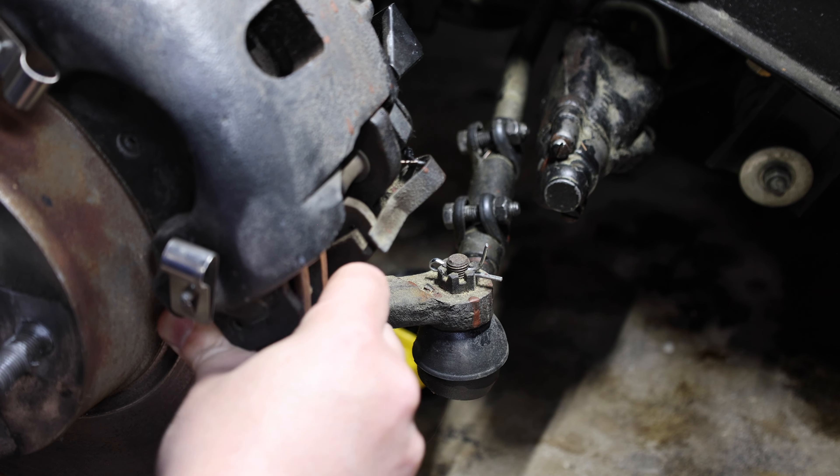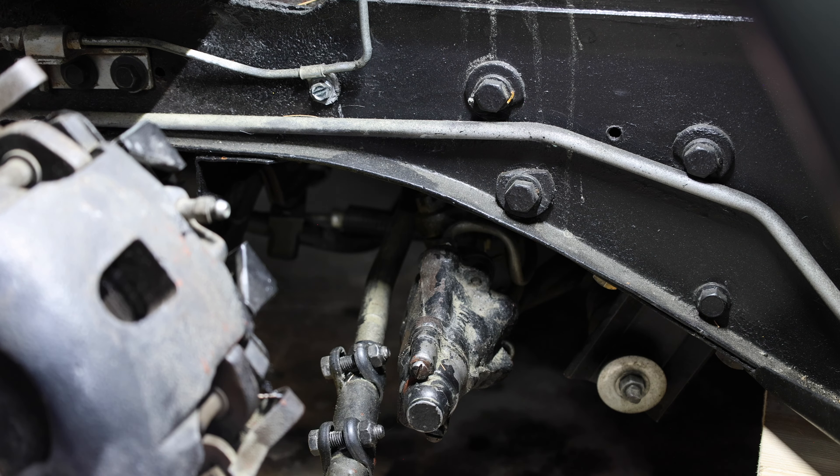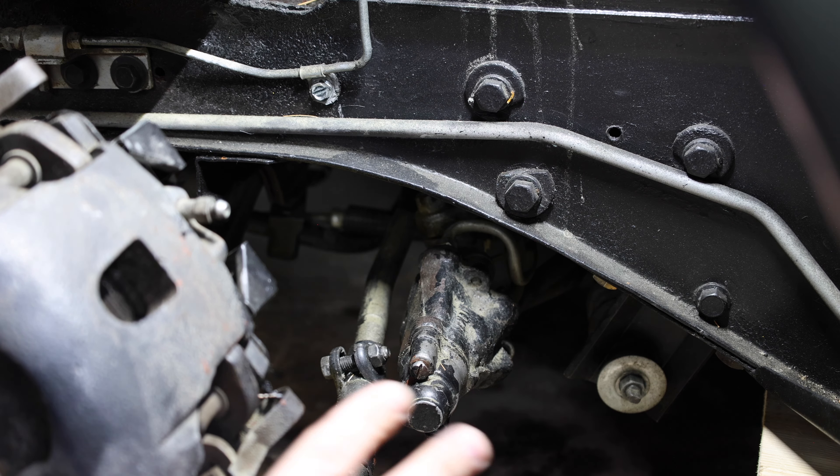I can see the steering itself — here's the steering valve. When I do this, the valve isn't moving. So essentially that means it's probably going to be the inner tie rod end. Unfortunately, my car isn't jacked up high enough for me to get to that right now, so I'm going to need to put the car up on ramps to check it out.